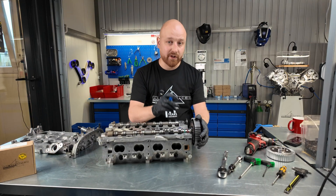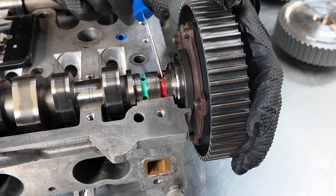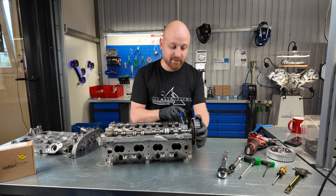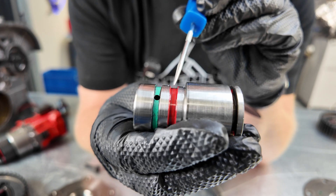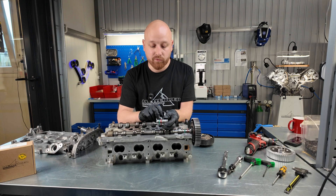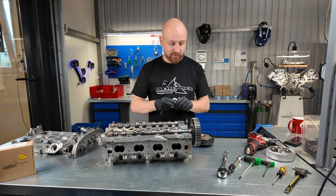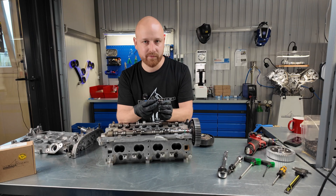When the engine is running at idle speed and the wheel remains in its default position, the oil from the solenoid valve gets redirected straight into the red disengagement section. When it becomes necessary to activate the wheel, the oil is redirected and flows directly into the green engagement section. Oil from the disengagement section flows directly into these three holes highlighted in red, and into this specific groove located right here. Oil from the engagement section — meaning when we activate the camshaft phase wheel — flows directly from this groove into the central hole in the shaft, ensuring proper lubrication. From there, via the screw that features a through hole, it flows directly into the camshaft phase wheel mechanism. So in this case, we have two oil supply paths.